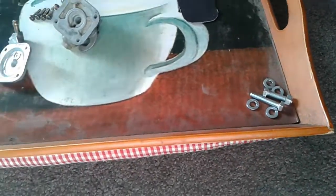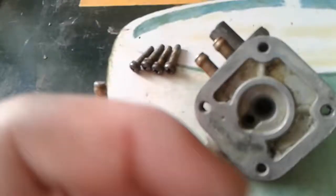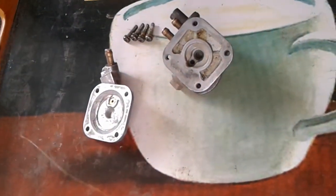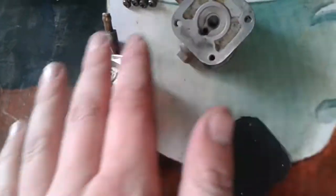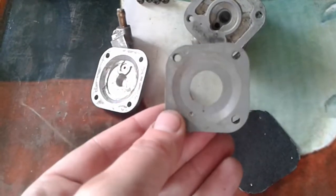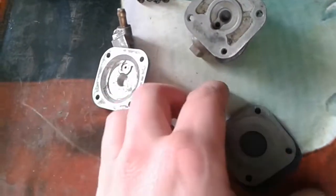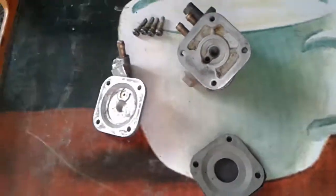I'll post little updates like this in the meantime. I've made up a gasket to go in between — hopefully that's going to seal up the leak in the fuel cock, because that is what I'm trying to achieve here. I'm emery papering it flat. This part of the internal diaphragm, with the gasket, should seal that up nicely.